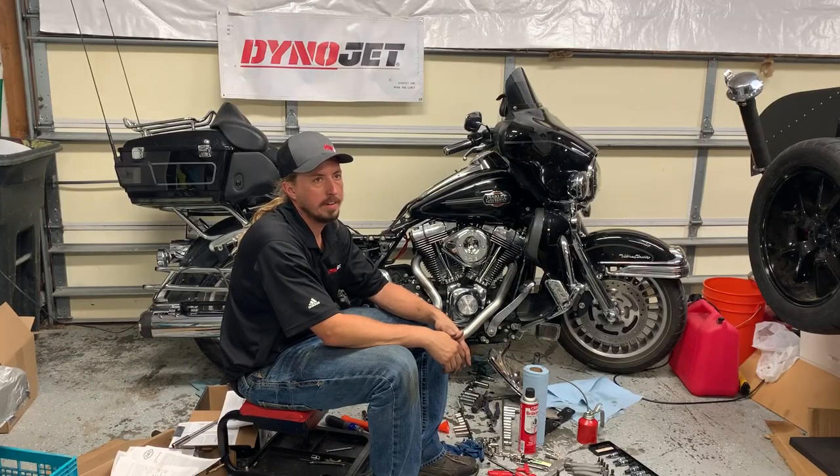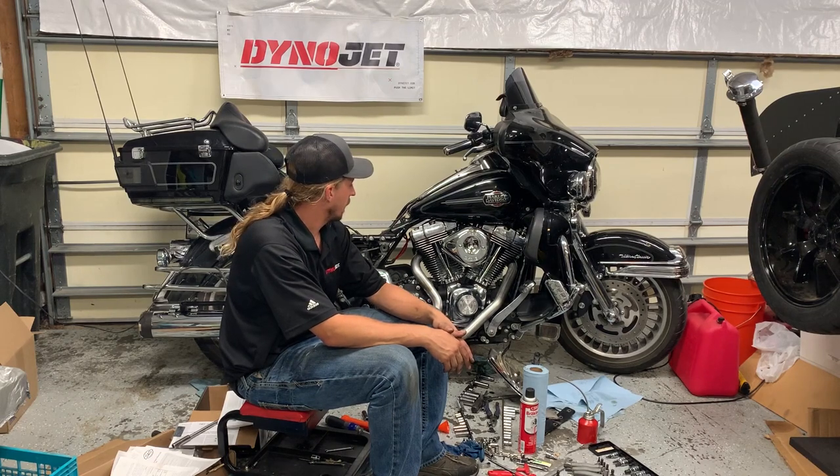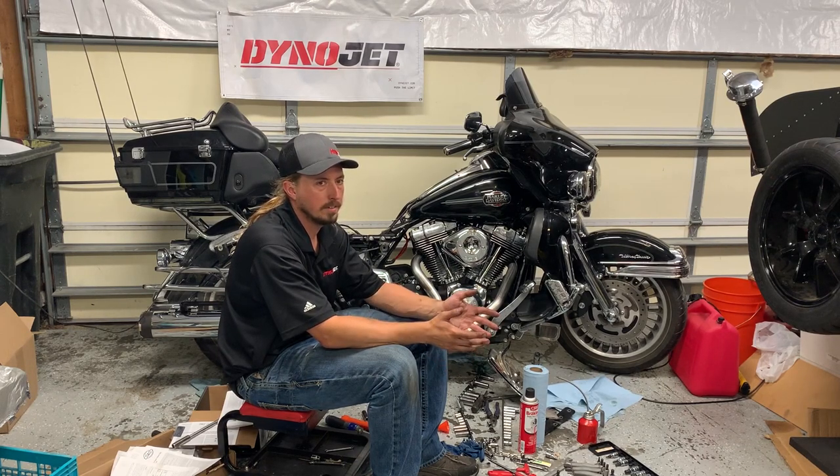Well, it's getting to be the end of my third day working on this motorcycle. We're at the point where we're ready for first start. The first attempt, it did not fire. Not necessarily surprising, the battery may be a little bit low from sitting. Didn't sound like it was cranking quite as strong as what I might want it to. Of course, now we've also got 110 inches instead of 96 inches, and we've got a higher compression ratio.